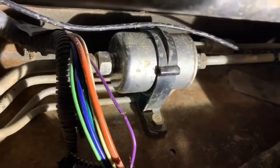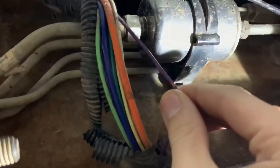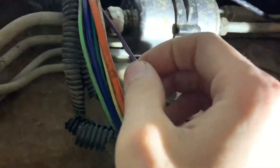Your first step is to come underneath the vehicle and find your fuel filter. It should be along the driver's side frame rail, and you'll find a wire loom that runs along with it. Cut open the sheathing and find the purple wire, then use some squeeze-type wire strippers to strip back just enough so you can get an alligator clip to jump this wire to ground.